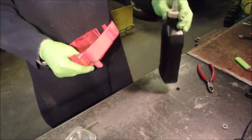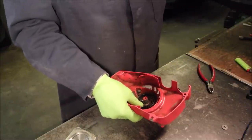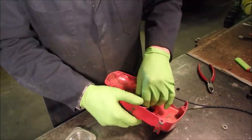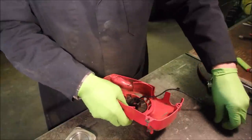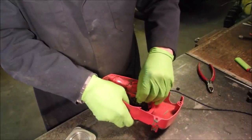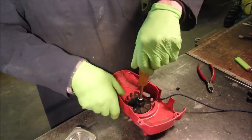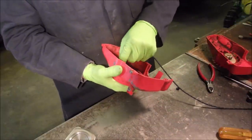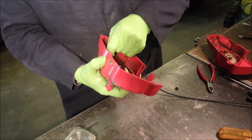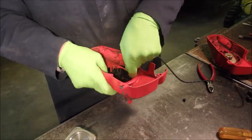And, you guys know this is my favorite oil. It's air tool oil. Well, what's more air toolish than a spring on a chainsaw? Okay, now we want to catch that spring. Right? Get the bolt back on so we don't have a kaspringer. And I say 6 winds, and we'll see how much rope we've used up. I think the spring winds this way. Yep. Okay, so I say 6 winds. 1, 2, 3, 4, 5, 6.